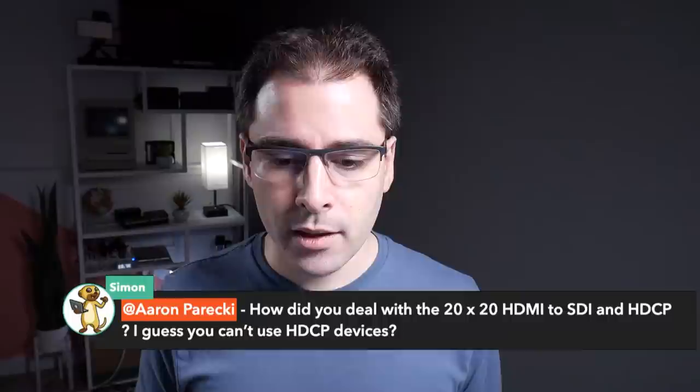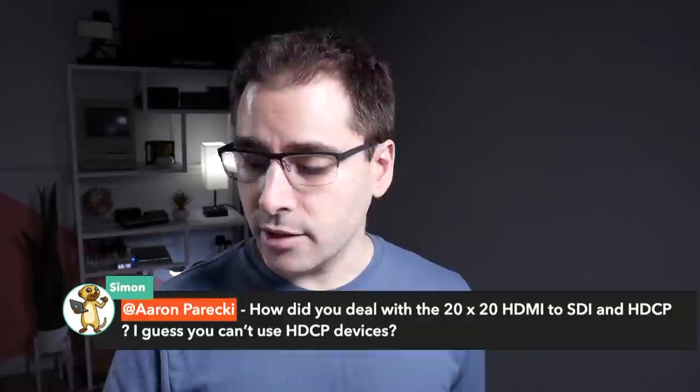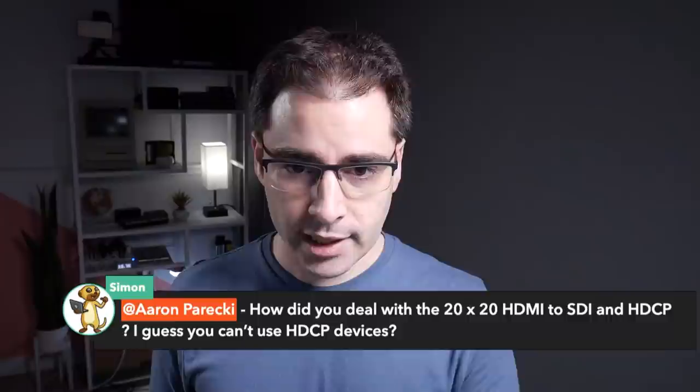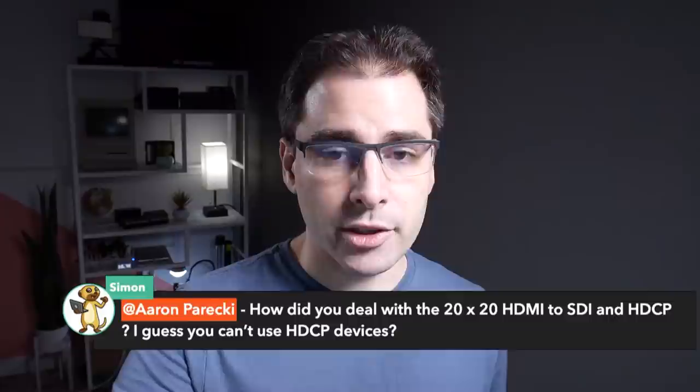So with any luck, that might change. However, the other part of the HDCP story is that devices that do support HDCP, like your Mac, if it recognizes that the source it's sending to supports HDCP, it will encrypt the signal. However, if the device says it does not support it, then it won't encrypt the signal. So it's about the sending device, whether or not it will properly negotiate or always go into HDCP mode, and the Chromecast is one that just always does HDCP.